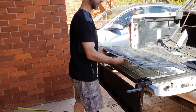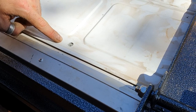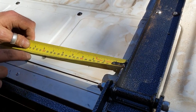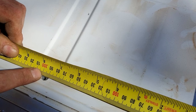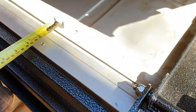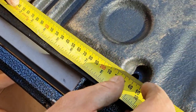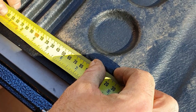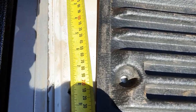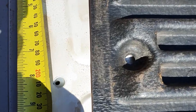I need to cut this panel down to fit, because obviously we now have a big old hinge in the way. So you see here you've got your bolt holes, and then you've got this little panel here. What we want to do is measure from there to there — I've got 195mm. Then if we have a look at this panel, measuring from the centre of that hole coming out 195mm will get me back around there. I'm going to give myself 5mm just to be safe, which essentially puts me straight down the middle — is essentially where I want to be. It's 209mm on this side.